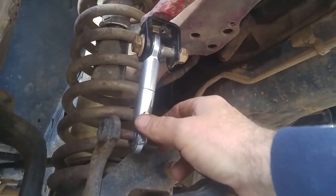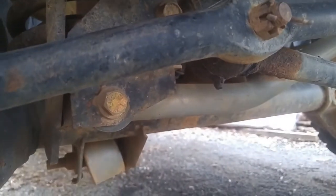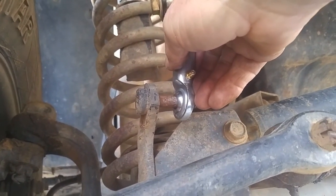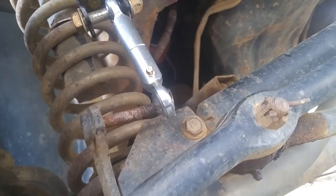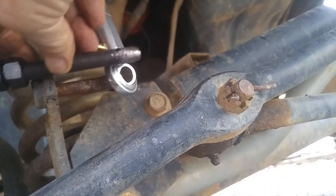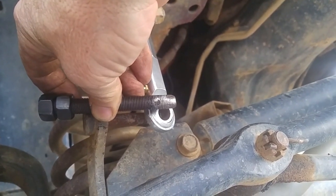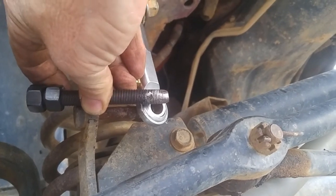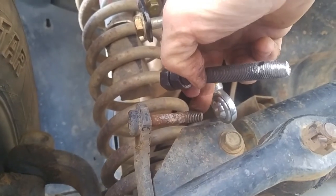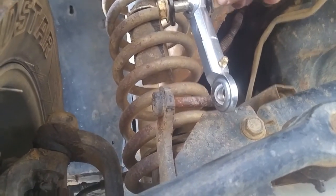I had to charge up the camera so you didn't miss much. I got this on both sides and everything's just hand tight — I haven't tightened anything down yet. There's just a little bit of play in that bolt. I made a bracket out of some of the half-inch rod I have. I can bolt that on there and adjust it to whichever length I need, then cut the excess off. Drilling the hole in that by hand was doable but kind of a pain. I've beaten these out with a hammer before — sometimes it bends, sometimes it doesn't — but I'm gonna try a ball joint press.